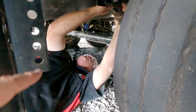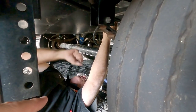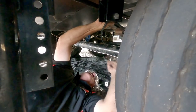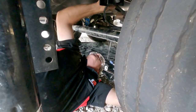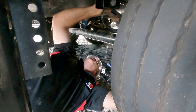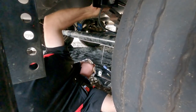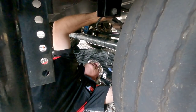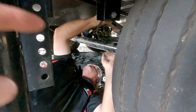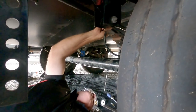Bill called me over because he's trying to figure out whether to run an 18 or 24 inch line from the undercarriage down to the axle and splitter. He decided the 24 inch is the better route because if you're changing a tire on the side of the road, the axle needs to hang down and you don't want to overextend the line. He's come up with a creative way of running the line off the front and S-ing it back, which gives it a little tension while still providing the flexibility needed for suspension articulation. You can see these really cool hangers he put up — a lot better than just drilling into the belly of the RV.